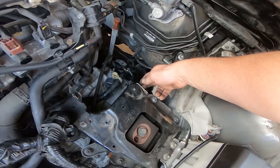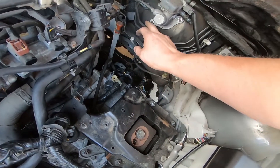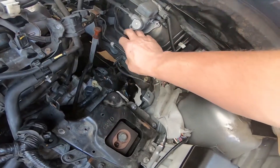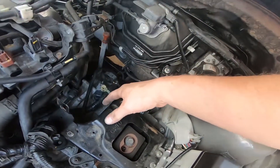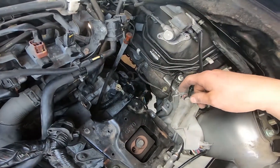The task at hand is to move this transmission controller module. A lot of people will zip tie it up here in its own little air zone. By getting it away from this heat-soaked aluminum, you actually extend the life of the transmission computer module.